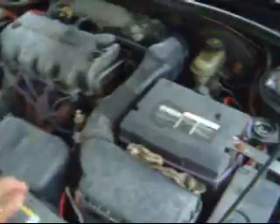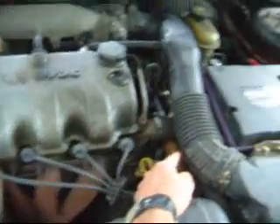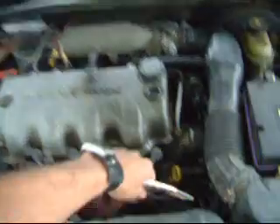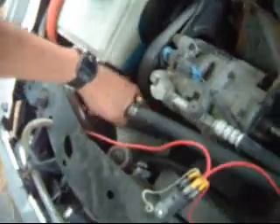To shut off the fuel heater, we've got the heater hose that feeds the fuel heater going right along through here. There's the fuel heater right there, and then we have it going back into the heater over there. Two ways you can shut it off: you can use a pair of needle nose vice grips, just put it right on the hose and squeeze the hose closed so that no coolant will get through. Or if you installed a valve like I did right down here, you can close this ball valve — I have another one set off over there as well.